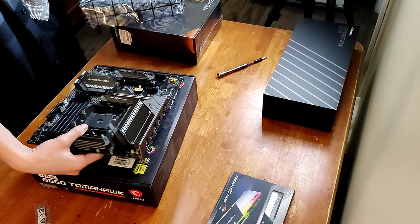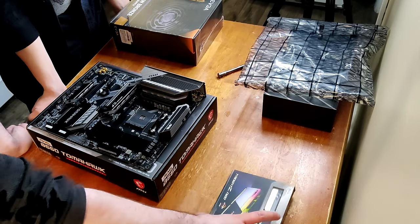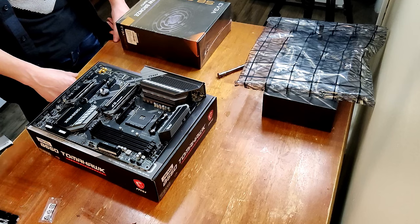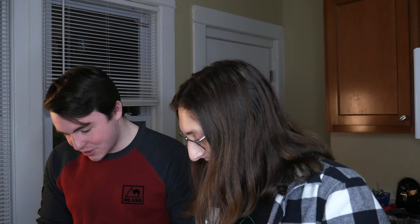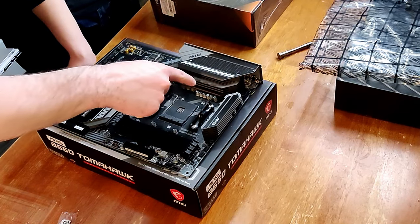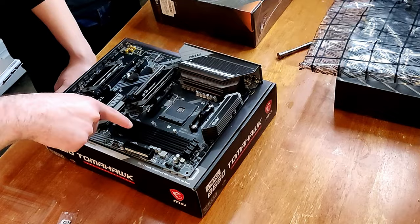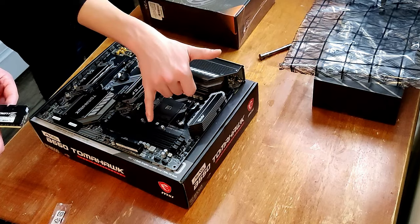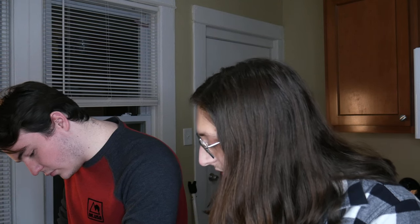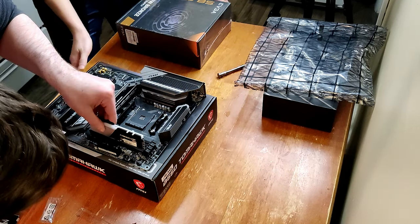What we're going to do is we're going to pull it out and set it on the box. Which one of these do you want to start with? I kind of want to start out with this. Now I've got to be really careful. So how are we going to do this? You just pull that out. Where do we have to put these? Where do you think? You're talking to a tech dummy, so I need to think here. Right there. No. Right there? No. How about right there? Yeah! You want to line it up with the notch in the slot. So basically we're going to do this slot and then this slot. How come two and four? That's the way the memory channels are hooked together — that's called a dual channel.